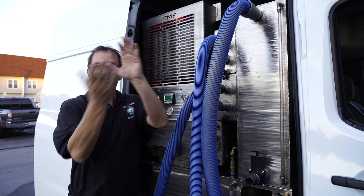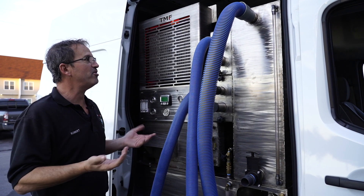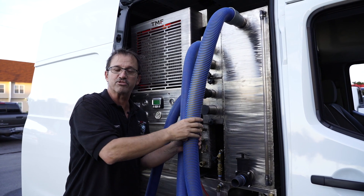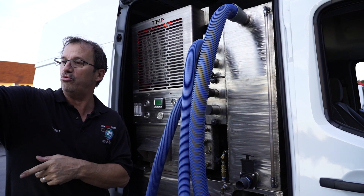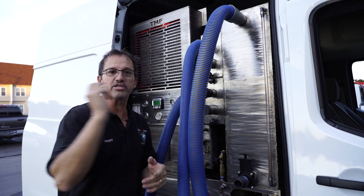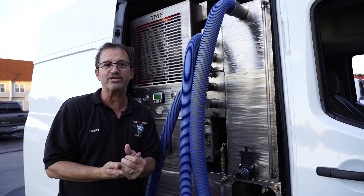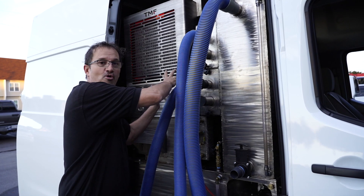It's like taking the blower and putting it on the front steps — you go in and clean, you're going to get some serious good dry times and can really clean efficiently. Other people prefer a 2.5-inch hose. The disadvantage is you have to carry and store that hose, and some guys just wrap it up and hang it in the back of the truck. You can run 2.5-inch to the filter up front, hook it to the back 2.5-inch port, and then go inside with 2-inch to start cleaning. This way you maximize your airflow, CFMs, lift, fastest dry times, and best clean — it makes a huge difference and maximizes performance out of your truck mount.